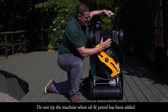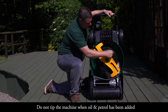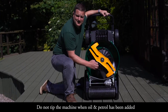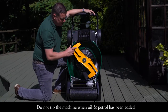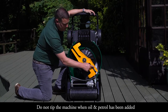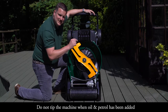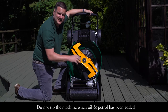We also have these fins, which are there to let air flow through the deck. Combined with this new guard that grabs air from underneath the engine, it helps push more air through and collect the grass into the grass bag. We've also got a twin clip blade — it has two cutting surfaces on both sides. It cuts the grass on the higher blade first, then recuts it on the lower blade, processing the grass into smaller pieces, meaning we can get 20% more grass into the grass bag.